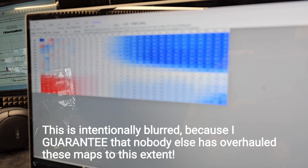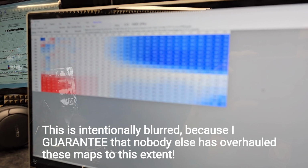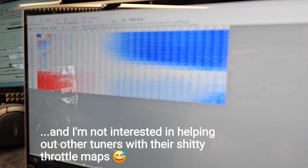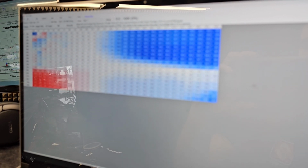And the throttle-by-wire mapping is pretty much the same garbage that we see out of all the Japanese manufacturers now that have to meet emissions compliance here in the US, whether that be noise emissions or tailpipe emissions. The throttle just doesn't open, especially in some of the lower gears. The throttle mapping that we've created to get these bikes to perform properly looks absolutely nothing like what they came with from the factory. The complete overhaul that we've had to do on this bike is truly not something I've ever had to do on any other modern Japanese machine.